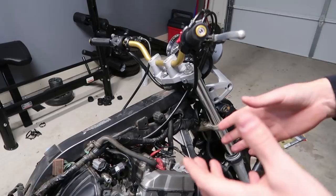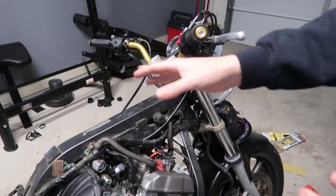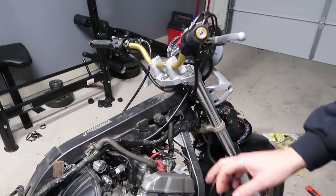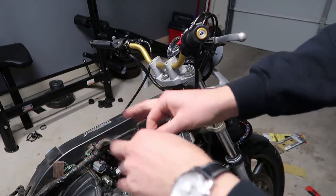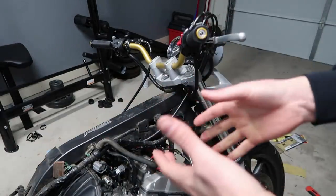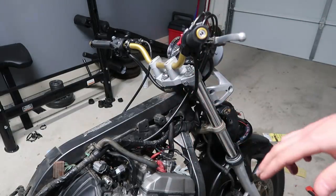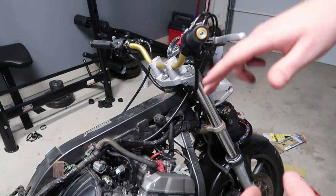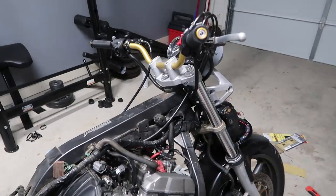It's crazy because even when he took off this entire assembly, we had to take off the entire throttle body. The actual little beads that seat the actual little drums that move and close and open the throttle body were corroded on there. They were actually corroded and kind of rusted on there, so he had to use PB Blaster and a Dremel to just drill them out. So it's a pretty involved job, all things considered.